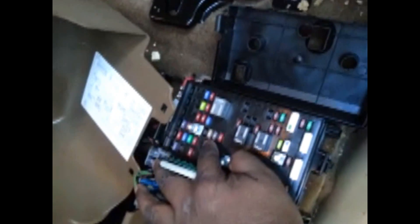And what we're looking for is the one for the brakes. On this one, it doesn't literally say brake — I think it just says stop vehicle. It says stop vehicle, but it's going to be number 34. So then you find number 34 on here, which is right here. Check the fuse.